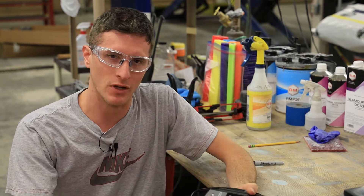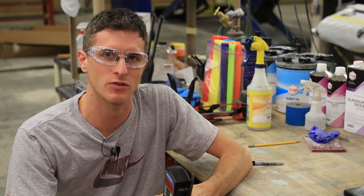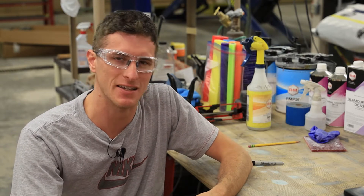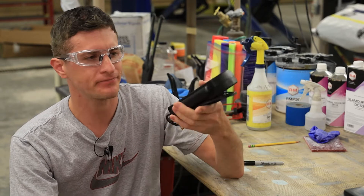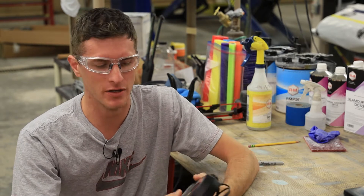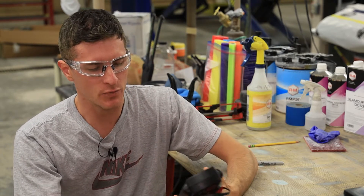It's great for doing a quick test on a battery here in the shop. Obviously a weak battery could possibly leave the customer stranded, and if you're in the business of selling batteries it's good to have hard evidence that the customer actually needs one. When we get to the disadvantages, a tester of this type is not capable of putting any sort of load on the battery aside from basically powering itself.